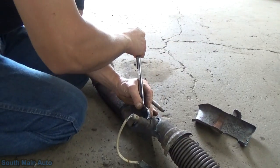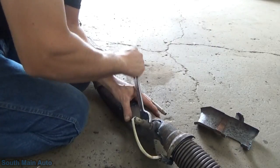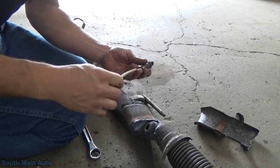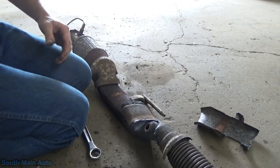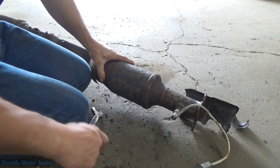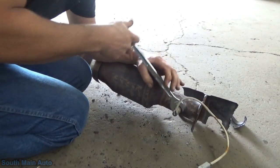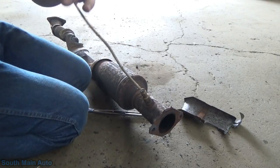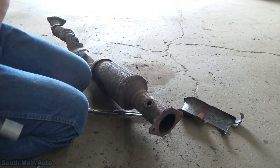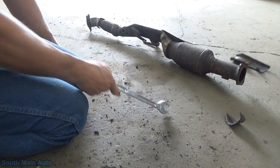Oh, Vinnie stopped by for his daily visit. Alright, so this O2 is the front one - came right loose, another miracle. So we'll reuse that. Of course people are probably screaming that they would have changed them and bought them all new and all that, but there's no codes, no problems, nothing like that - so I'm not just going to throw 300 plus dollars worth of O2 sensors in it just because. Now I have seen from experience taking out O2 sensors and then shortly thereafter getting an O2 sensor heater code - I don't know if that's because of the shock of taking them out or what, but we'll cross that bridge when it comes.